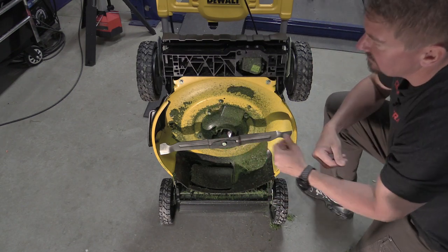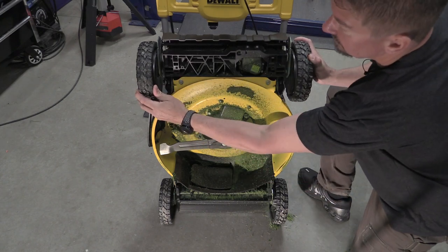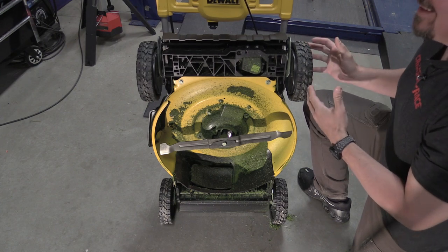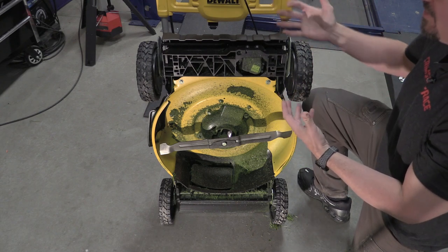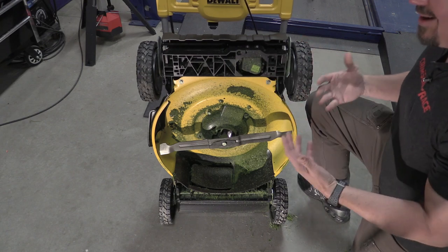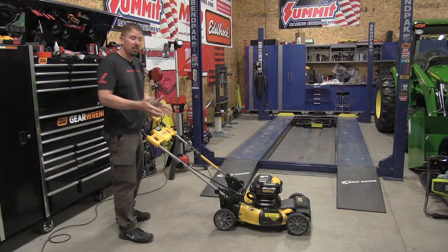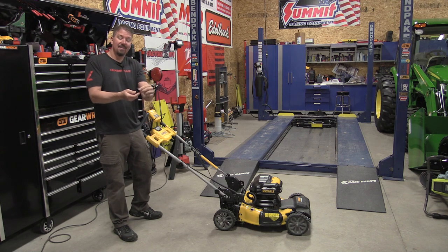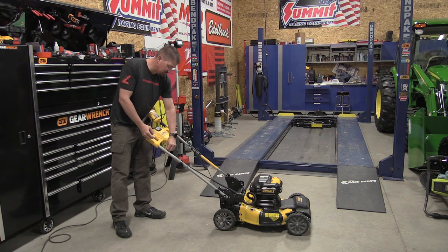As far as cleaning the deck, just don't spray anything directly into the area behind the mower, but you can power wash it off just like a normal mower. With the self-drive system, it is a solid axle going through here, so these two tires turn together at all times. There's also some resistance when pushing — this does not let off, so there's always going to be resistance even if you're not using the self-propulsion. There is also a safety key at the bottom — without it you cannot run the mower.